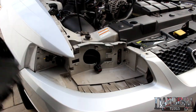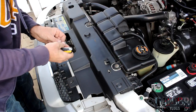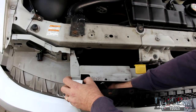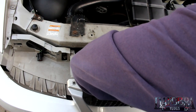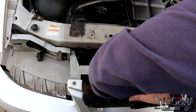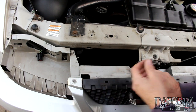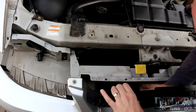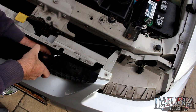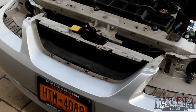I also chose to remove the radiator cover to access all the bolts and clean underneath. They bolt in from the bottom, so my advice is to be patient and very careful — they are kind of tough to access, but it is doable. I was able to remove them with a short combination wrench. The grille is now able to be removed.